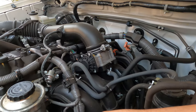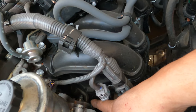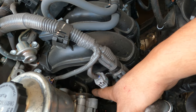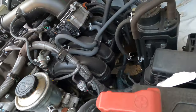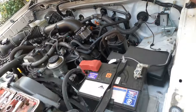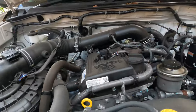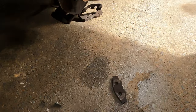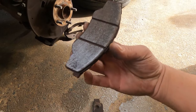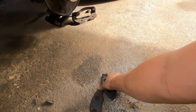Normally on the old cars, 2010 and down, they used plastic hose and it always cracked, but this one they changed to metal hose, so that's good — no water leak or anything. Today we also replace full service oil, pads, and take out the discs for machining. The disc is worn out this much as you can see, and there's a problem with the brakes.